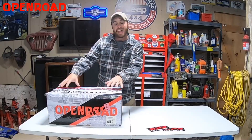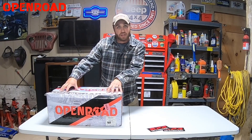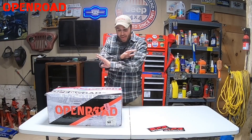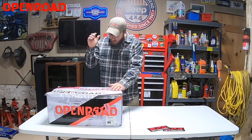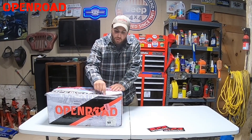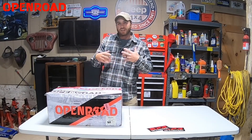What's cool about this winch here is it is a Panther Series 2S winch. It's a 13,000 pound synthetic line winch and it comes with everything you need in the box to set this thing up — everything you need and nothing that you don't. It has an 85 foot synthetic winch line. Also, the solenoid on top can be moved. We'll open this up here in a second and I'll show you all that.